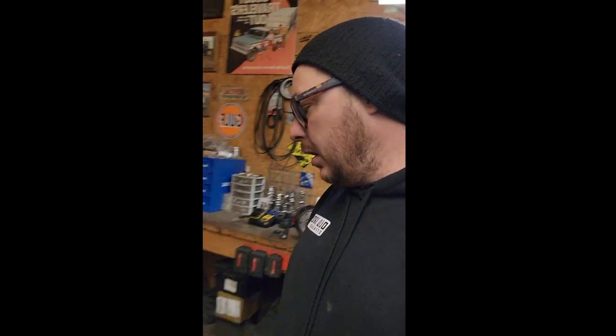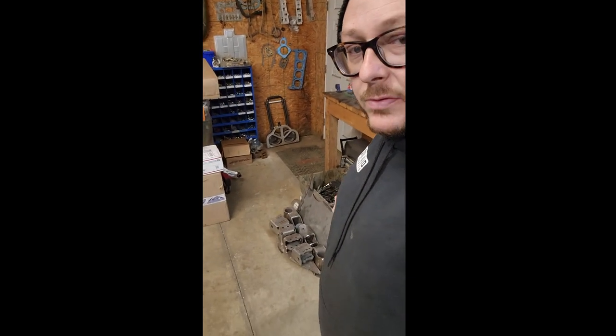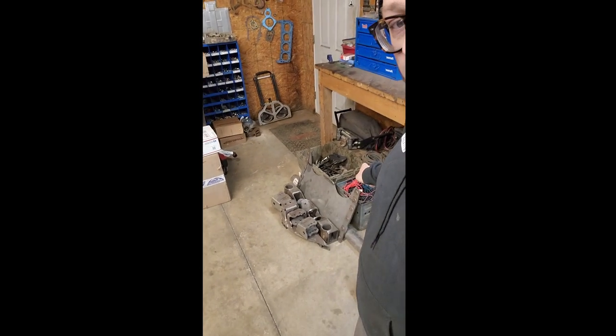If you remember, we built this Dana 300 sometime back, and it is still sitting where it was when we finished building it. If you're not familiar with the video, we built a full 32 spline Dana 300 with a 4-to-1 ratio that we are going to put behind a 4L80E with a full manual valve body. It's going behind a 4.3 liter TBI engine that is going to go in our personal rock crawler build. We've also got some parts from Chris at the 4x4 garage laying on the floor here.